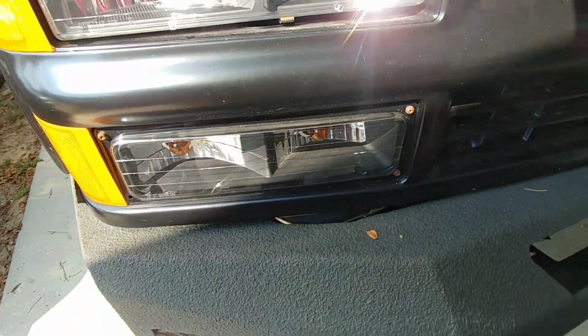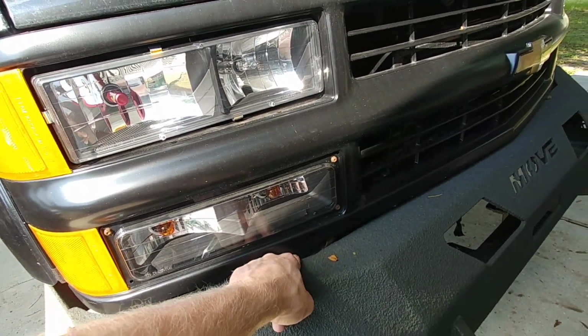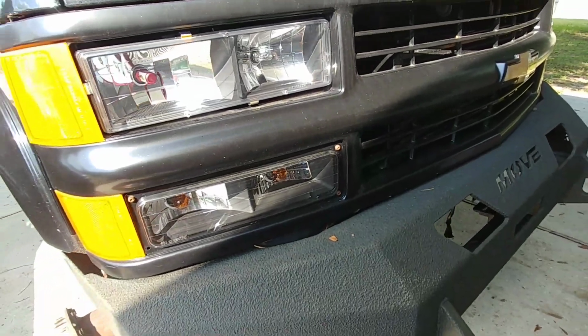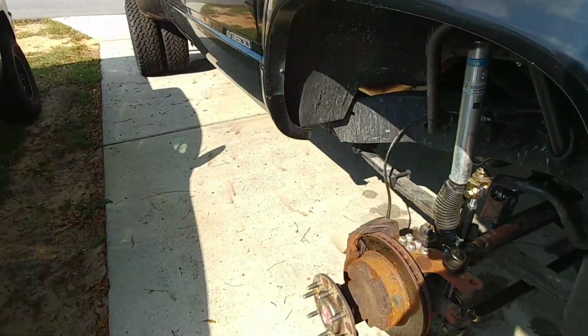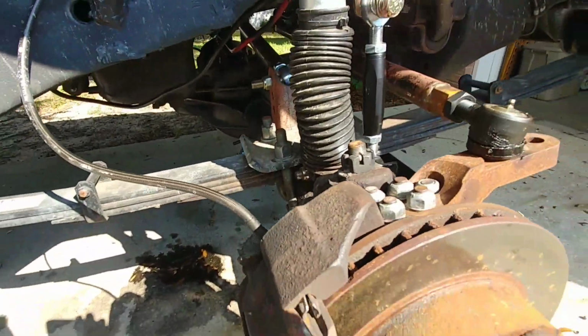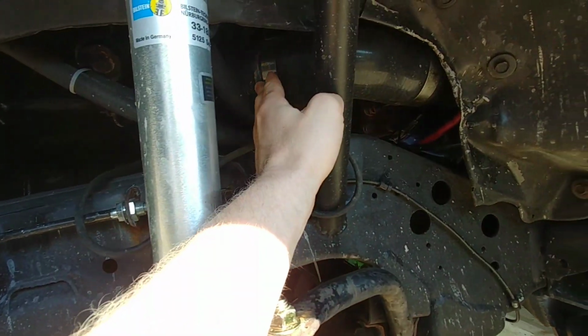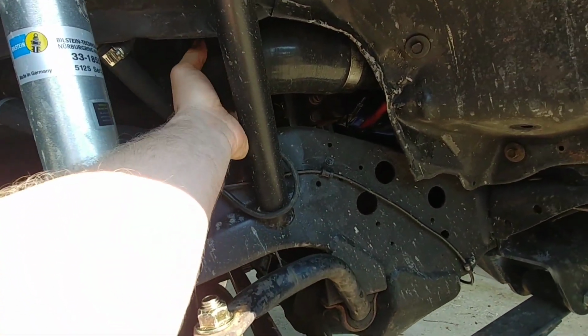Turbo tube and everything did fine. Blew this turbo line just before I did the trip because I didn't flare any of my pipes after I cut them. Yeah, I know, common rookie mistake. I didn't think I was going to need to, and I ended up needing to. And figuring out how to put a nice bead roll on them was kind of a pain. I did it fairly easily, but it was still a pain.